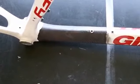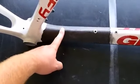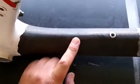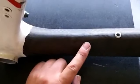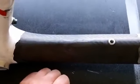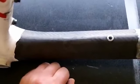Alright, so I let the epoxy and graphite powder mix set up — it took about an hour and a half, two hours. I went ahead and sanded it down; it didn't take very long. You can see where the graphite powder filled in — there on the top and on the side. All that's really doing is helping to keep air from circulating from the inside of the tube up into my vacuum bag. Just be careful not to squeeze on that or think this is structurally strong after adding the glue — it's not. We still have to add the carbon fiber.